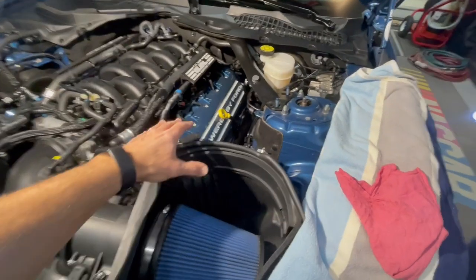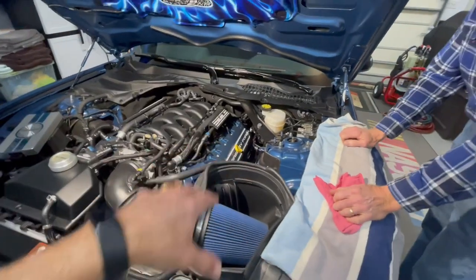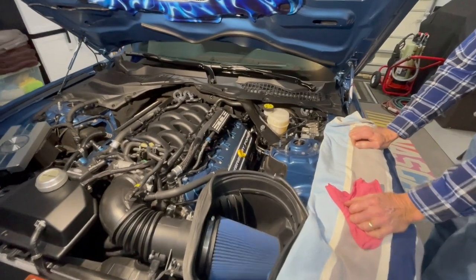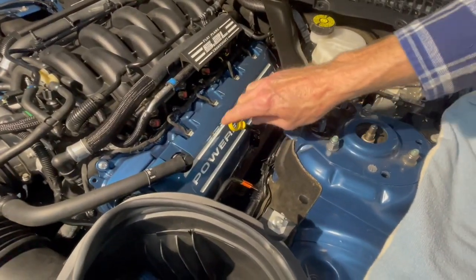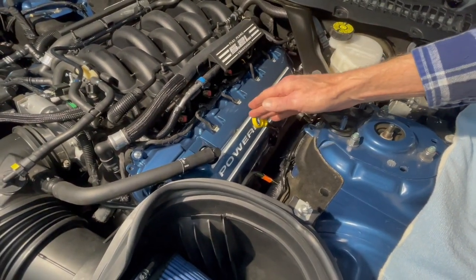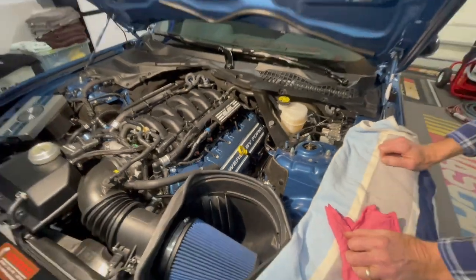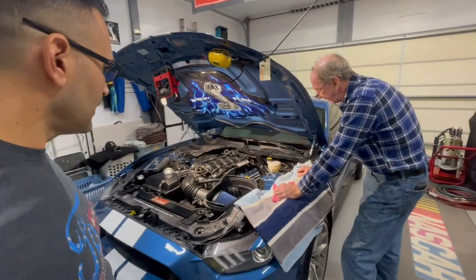George noticed that with this tube installed, the driver side performance oil separator will not fit because of that extension now. The tube on the intake side runs right over top of this. It will not work unless you wanted to fabricate a new tube somehow. That's the only way to do it, but then it really crowded the area up a little bit anyway. So I think it looks pretty good that way.